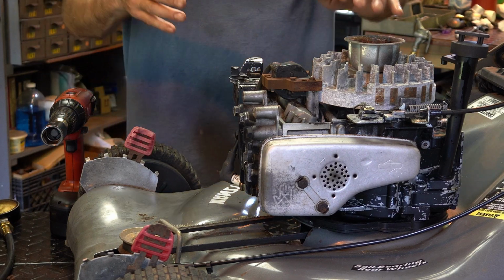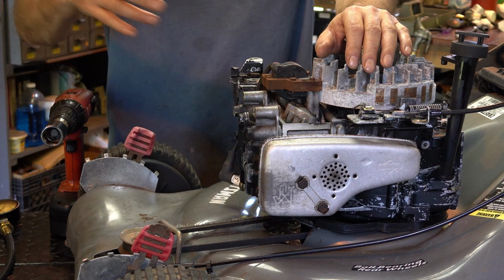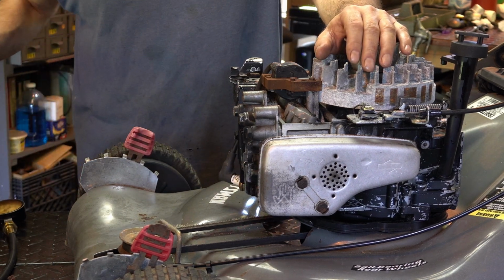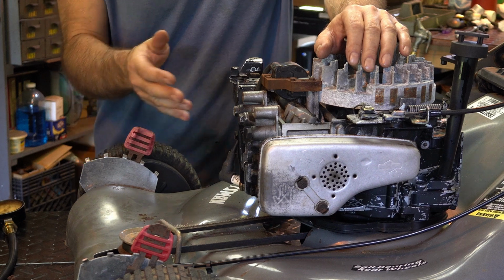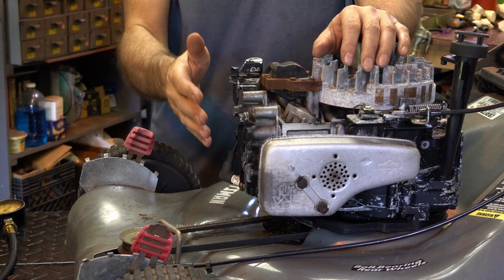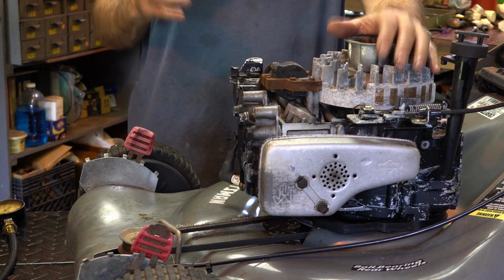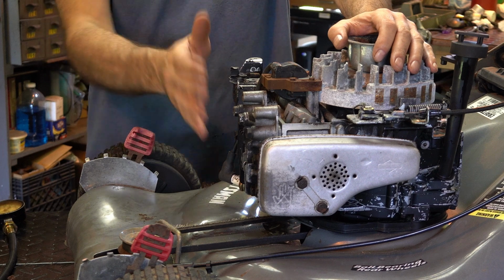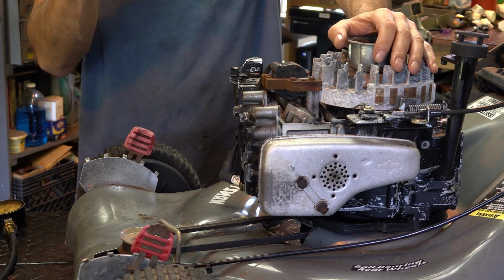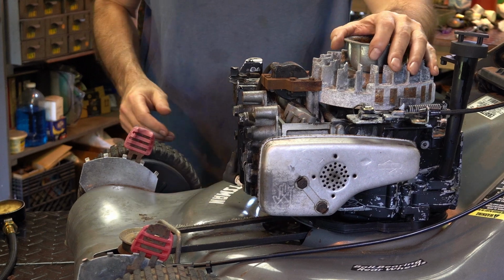Just a quick spark plug test. I tightened all these up. They were a little bit loose. It's customary to be loose over by the exhaust. Things expand more. Don't try to torque it. It won't do you any good. You will not get a correct reading. There's way too much friction and junk and gook on the threads. You're just never going to get a proper torque reading. Make it tight. I wouldn't recommend trying to take them off. That's a whole other issue. I don't want to get into it here, but you could break the bolts. So just give it a good tightening.